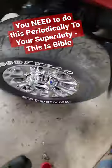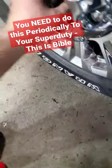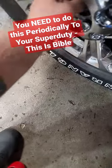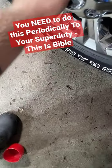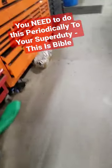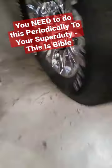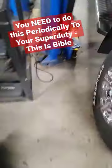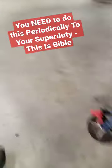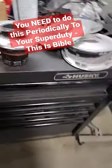It should just be this easy. Every once in a while, go up to your truck and turn your hub locks, move them around a little bit, because eventually if you don't do that, not only can you create a steering wheel wobble and jiggle, but also driveline vibrations that may be misdiagnosed.